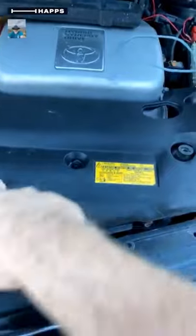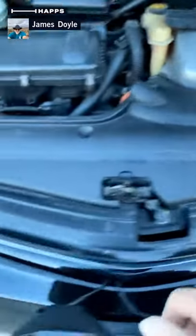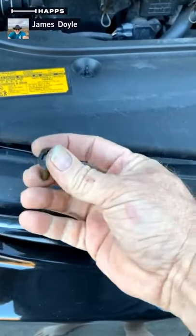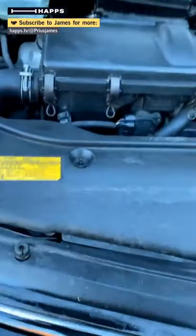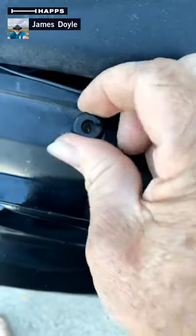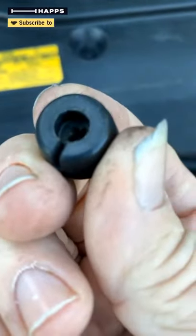The radar is actually right under here. The fact that this is up here and it's called a radiator protector is kind of weird, but it is what it is. So I'm going to unscrew both of these. I ordered new ones because this one didn't work properly — to get this one out I had to take the rubber part off using a pair of vice grips. The Phillips head in there is kind of stripped out — you can see there is actually a Phillips head screw down in there. This one's stripped and that's pretty typical if the car has been subjected to any moisture.